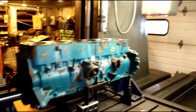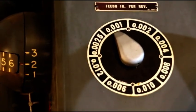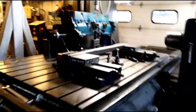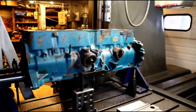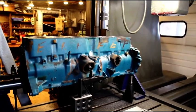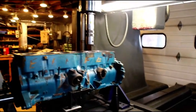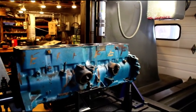The nice thing about the SIP is I can set the cutter and then play around with my feed rate to get a single pass cut. Right now I am on a 1,000th of an inch feed. Normally I bore at 4,000ths, but we are going from — at the very bottom of the hole we're standard bore, 3.750 — and at the top we're close to 3.780. So that's why we're going 60. I've got a slow speed on my feed and the same RPMs I normally use.